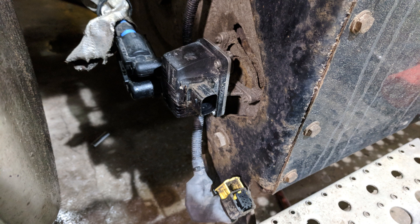To remove it, just disconnect the electrical connection in the front and then the two DEF lines feeding it. Be sure to keep the electrical connector away from any DEF that may be spilled out of it — it's very corrosive to electrical terminals in these plugs.